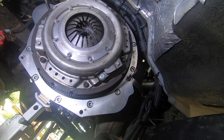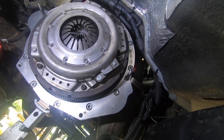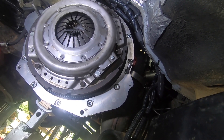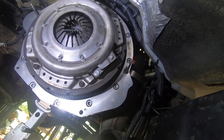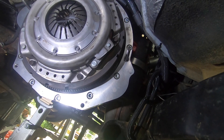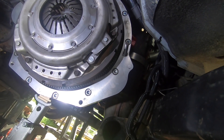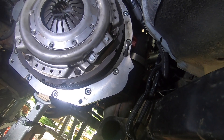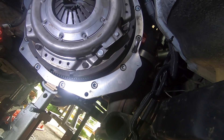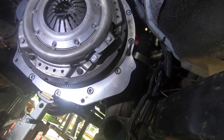Hopefully I'll go a while without having to fix something major. I basically treated the main adapter like a flywheel and did the procedure from the Cummins manual. Then there's the adapter that goes to the engine, the adapter that goes to that adapter, and then the flywheel — I did the procedure a couple of times and then did the clutch. Now it's basically just about ready to go back in. I lubed the shifter and I'm going to start trying to get the transmission in — yippee.